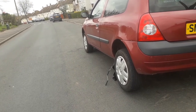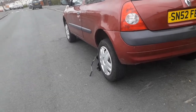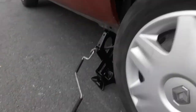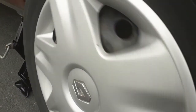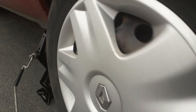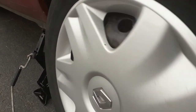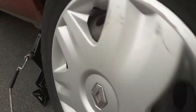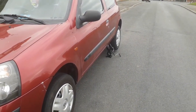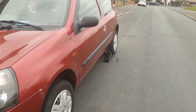I've just lifted the car up and I think I found where the noise was — it's that wheel there. You'll definitely be able to hear it when I spin it now. The passenger side rear, that's the culprit. You may need to go to the scrapyard at some point to get a new wheel bearing.